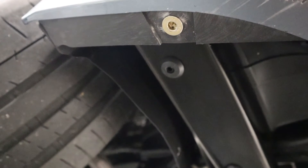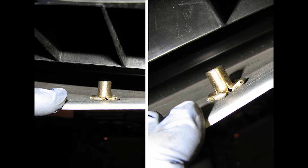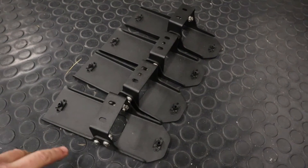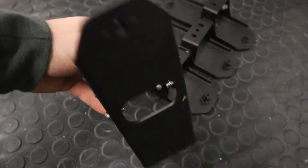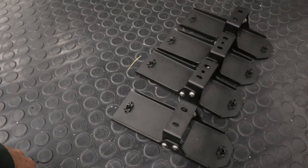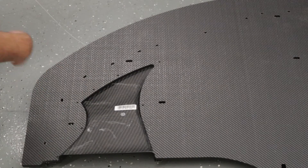At this point we have all the rivets installed on the crash bar, and we need to install one rivet into the bumper — that's a plastic rivet and that hole is already there from the factory. We just need to enlarge it to 3/8 inch and then install that. On the ground I've done some prep work: installed the upper brackets and the lower brackets together. You don't have to do that, but it's easier off car. We use the 16mm button head cap screws, small washers, and nylocks on the back, and those already have floating nut plates installed for a little extra wiggle room.